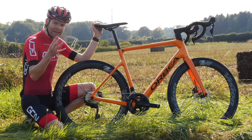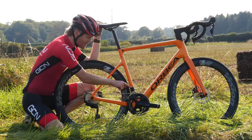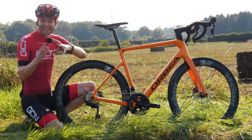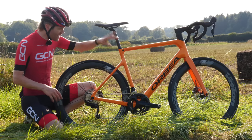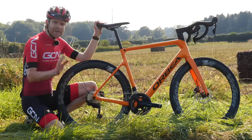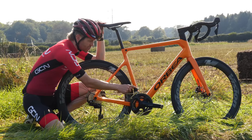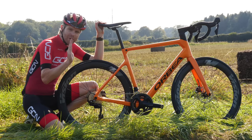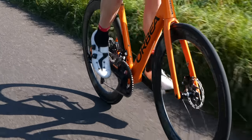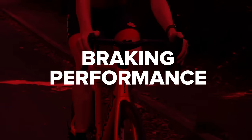We also have the inbuilt cable tensioner or barrel adjuster built in to the front mech. You can actually adjust it by way of this little grub screw here. On previous Shimano mechanical groupsets, you actually had to have a separate barrel adjuster somewhere along the cable for the front mech. On our Argon 18, you can see it's on the down tube. To make sure that you get the cable tension absolutely perfect, there's a handy little guide built in next to the tensioner bolt here that you can line up, and it tells you when it's right, and that will enable you to get both shifts from both rings, but also both trims as well. And on previous mechanical groupsets, this kind of required a little bit of trial and error.